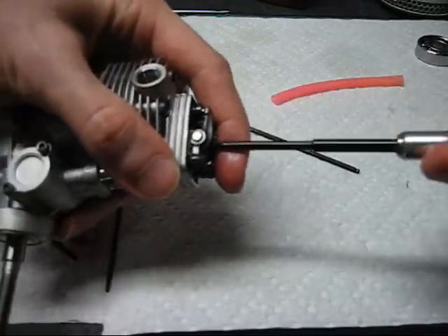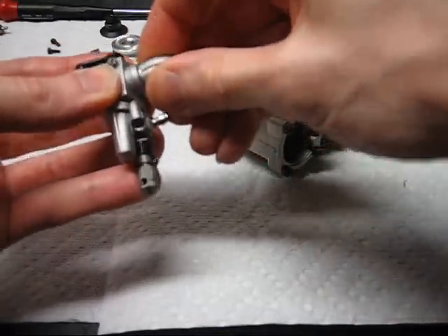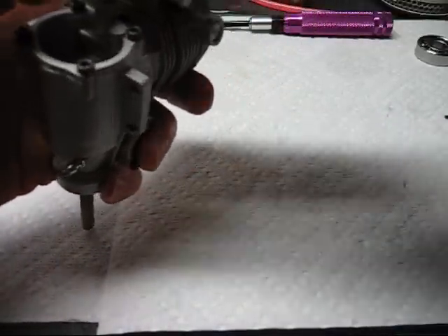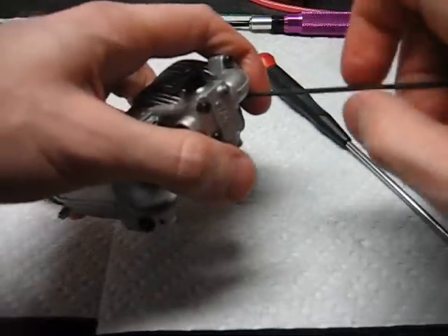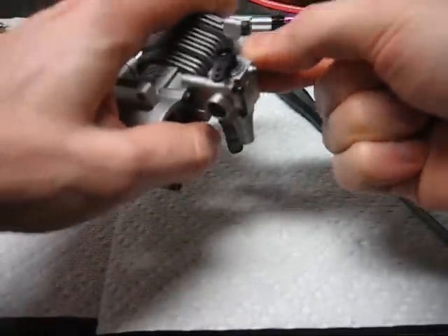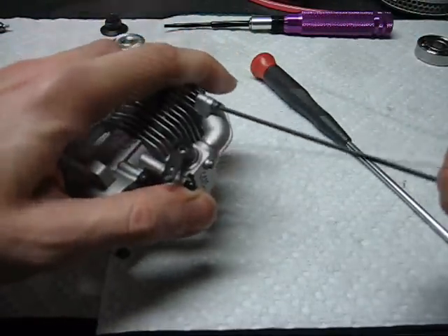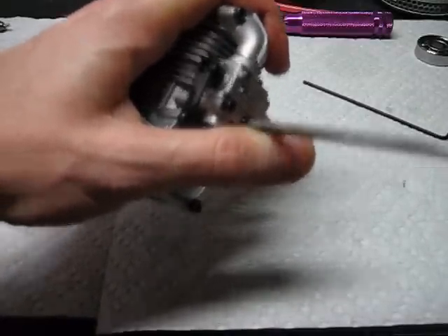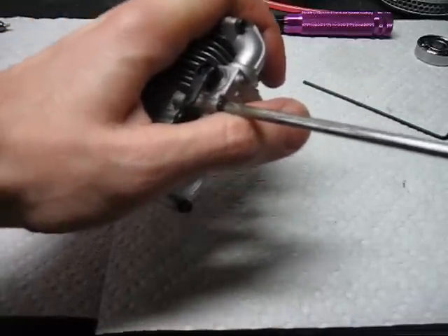Using the torque wrench again, torque the back cover plate screws. To install the carb, it seems to be easiest to put it on the manifold and put it in place together. These screws are just lightly being snugged at this point to help align things. Once alignment is okay, torque them down. The carb screws are Phillips screws — they're very easy to strip without the proper screwdriver. Make sure your screwdriver fits correctly and use firm pressure to prevent the screwdriver from slipping out.